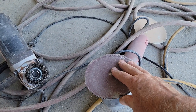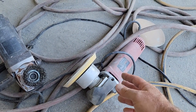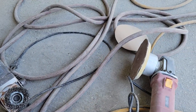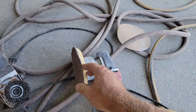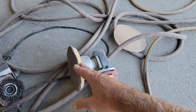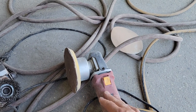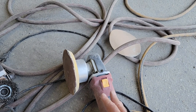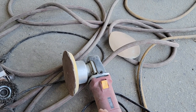What I'm doing on mine is sanding it with this machine from Harbor Freight Tools — it's a polisher/sander, a DA, so it's orbital, it doesn't just spin. It removes material and you can feather sand with it. It's very aggressive and sands much faster than most air sanders.